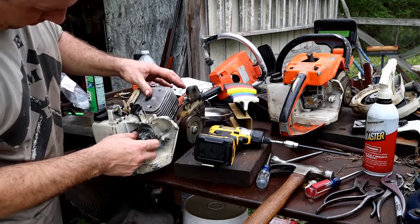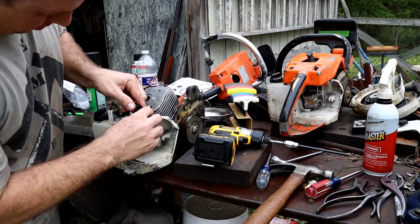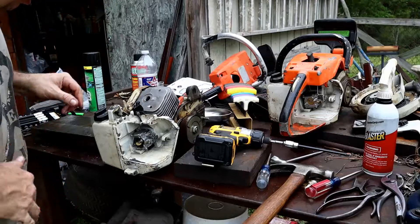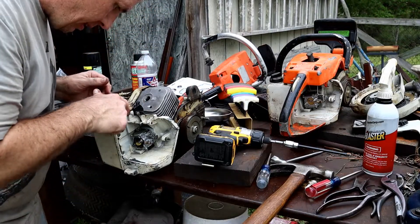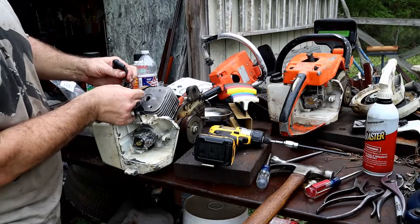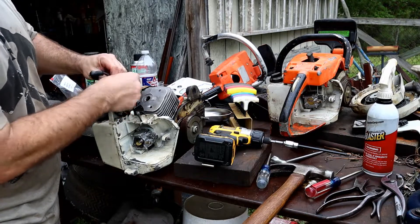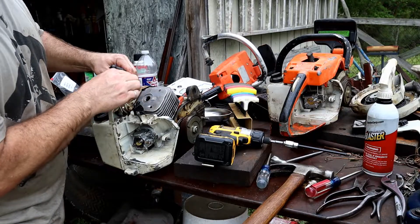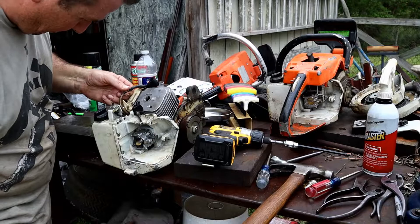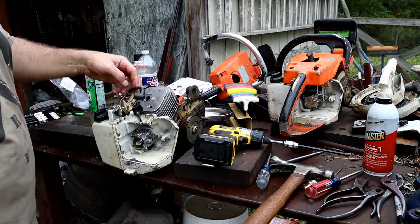Next step — it's got this assembly here. Kind of nice, they've got the choke up here on this connection versus somewhere else. Got to be careful with that exposed. The on-off switch has exposed wires, so I'm going to have to rewire this anyway. The spark plug wire has a big chunk of tape on it — I'm going to pull that off to make sure it's not going to give us problems. They made a solder repair there, which is not really the right way to do that.